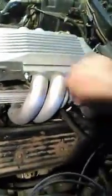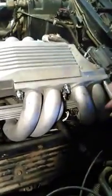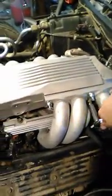in case you're wondering, these are 8mm by 1.25mm on the thread pitch. I'm using, honestly, these are nuts I got from a recall when I was working at Dodge for their brake booster. They got a lock nylon aspect to it. Really great for engine components that don't get hot. And this is one of those. It should not be getting hot. Never use nylon in exhaust. It's a pointless effort. You'll need to get what's called a pinch bolt. Lock washers are fine and all, but pinch bolts actually grab onto that stud.